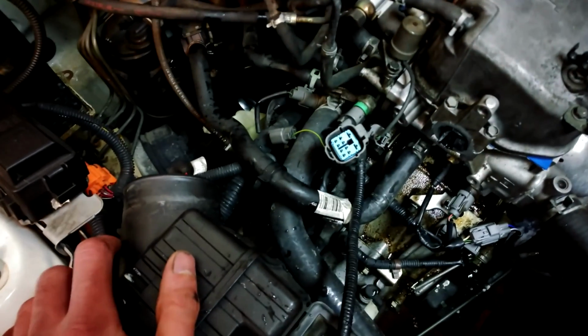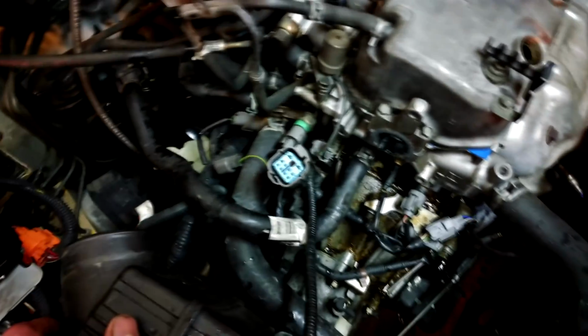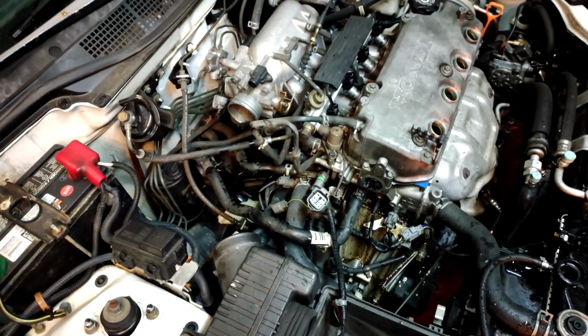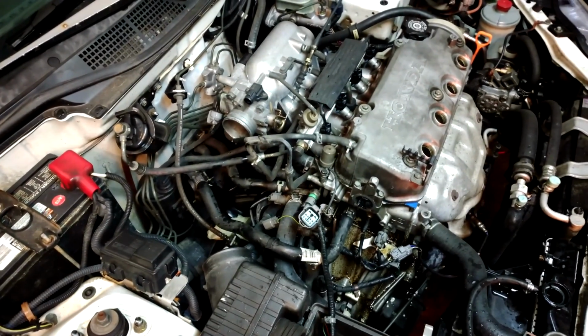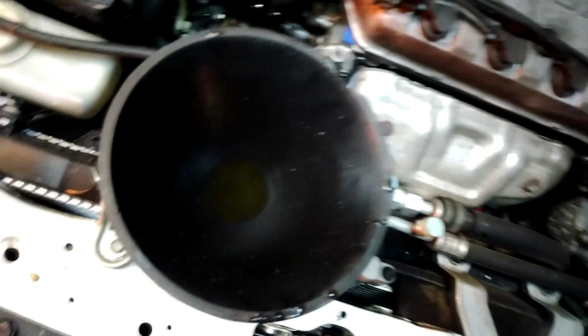So I'm gonna go ahead and button the Civic back up, top off or add coolant, run it, heat cycle it, top off the coolant, and we'll see where we stand. Fingers crossed, I guess, but kind of went into this expecting to have to put in a new heater core, because I was just getting absolutely no heat at all, and I think that Blue Devil head gasket fix really gunked it up.